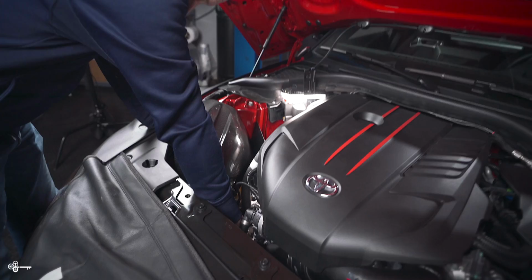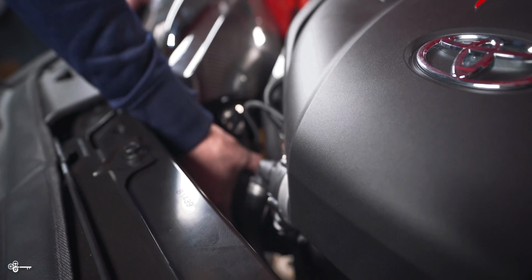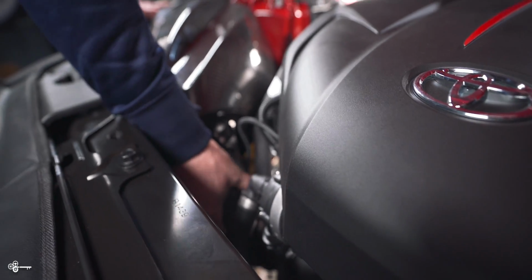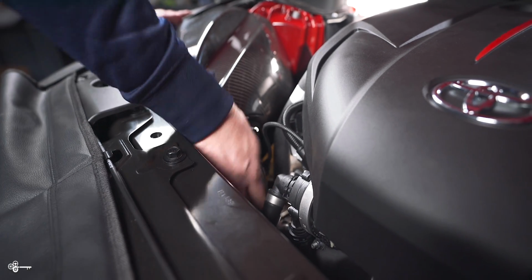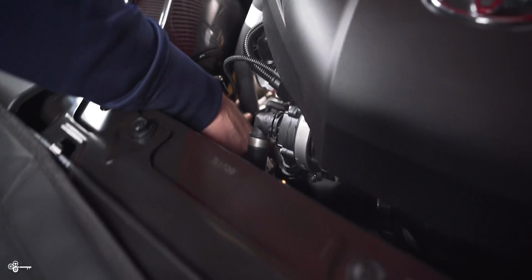And we're going to take our inlet here, which is super loose. We're going to slide this on. Now it's 2 parts. You got to slide that on, and you also have to reattach this vacuum line, if you can see this here. So once you have this in place, there's just 2 more connections. You need to get your hose clamp and tighten it on the plastic little inlet piece there. And then this little vacuum line that we removed earlier just needs to get snapped on here.